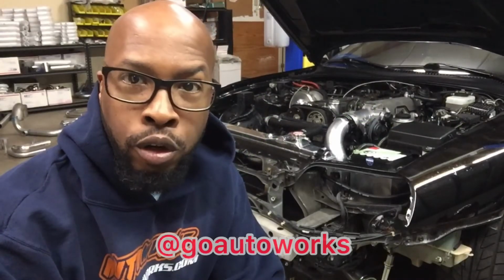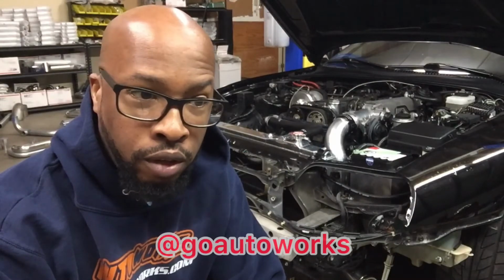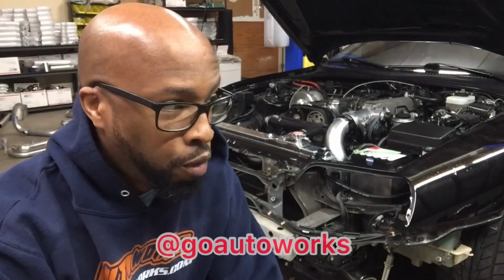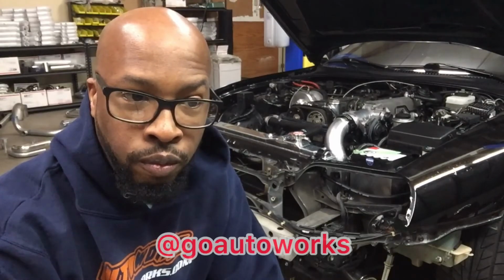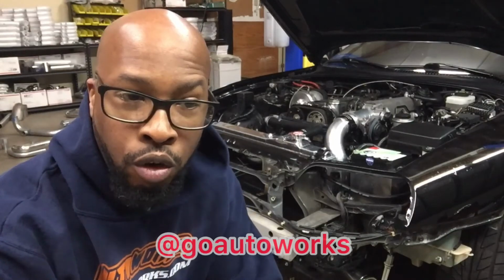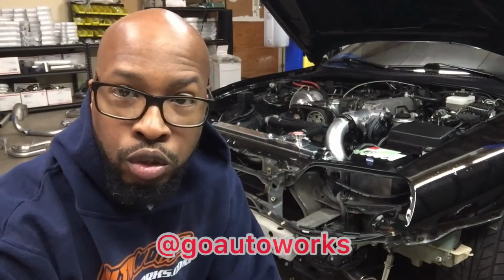Okay, now we've got the bulk of the parts installed that were brought to install on the car. The Powerhouse pulley set, the ATI dampener, we got the new battery in place, all the vacuum hoses redone. We got all the cheesy stainless knockoff hose off the car to bring the build up and make it more presentable. So now we get to the part that I was more so commissioned to do, which is the charge pipe and intercooler building. We're doing a 3-inch charge pipe set on the car with a 4.5-inch thick intercooler that I'll build all of that. I'm also going to use one of our new 50mm blow-off valves. And I've got to go in and also HD clamp the compressor housing. So all of that will get done to bring the turbo kit together on the car.